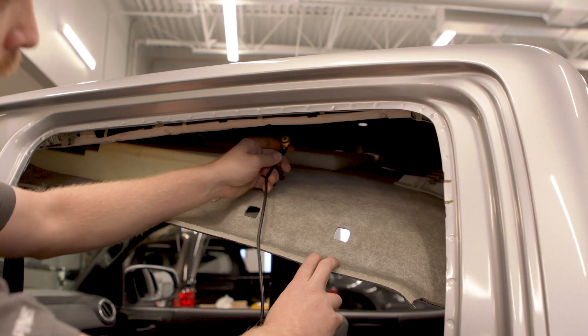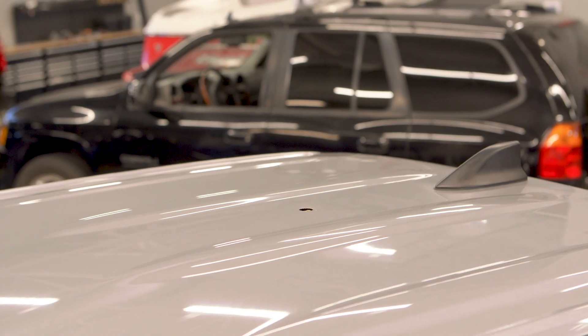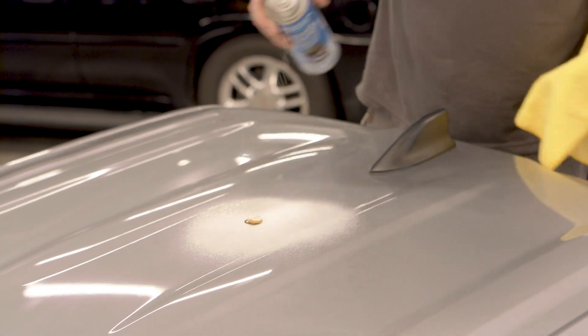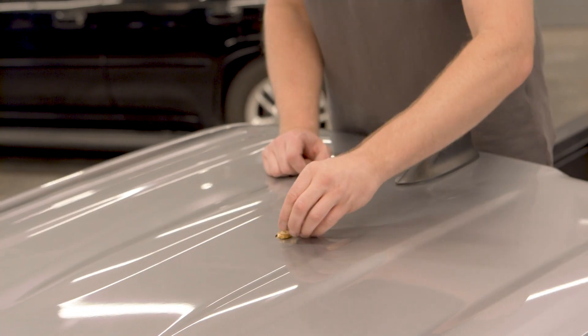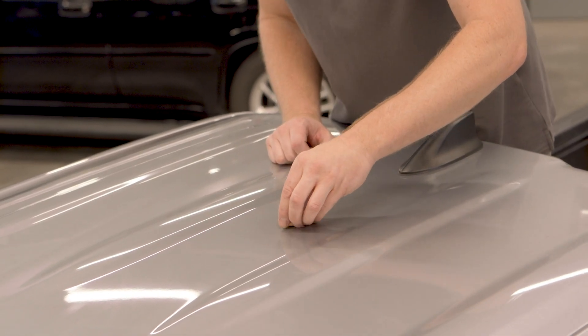Run the cable underneath the headliner inside the vehicle, and position the cable mount through the center of the hole. Next, thoroughly clean the mounting area. Now you can screw the collar you removed from the antenna connector onto the NMO mount, making sure the mount is centered.